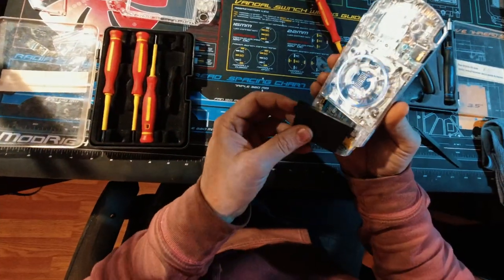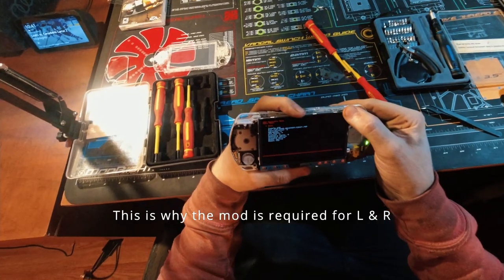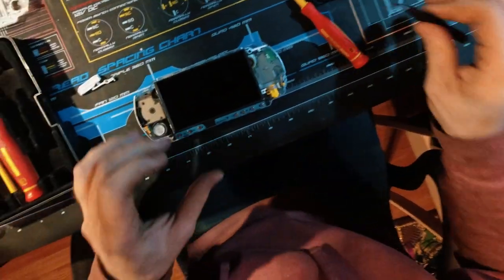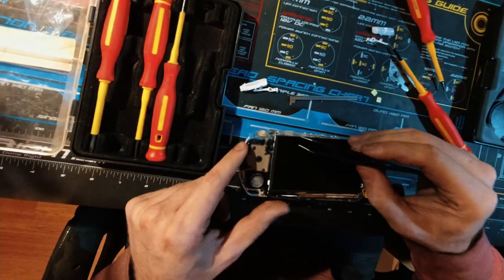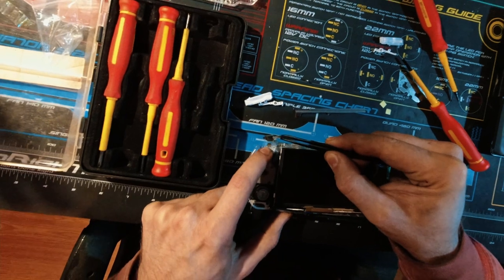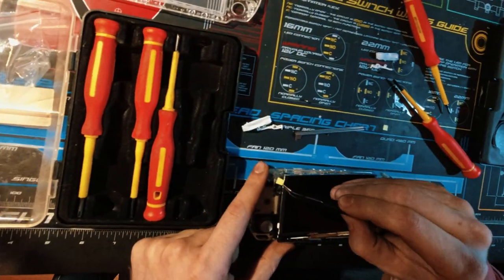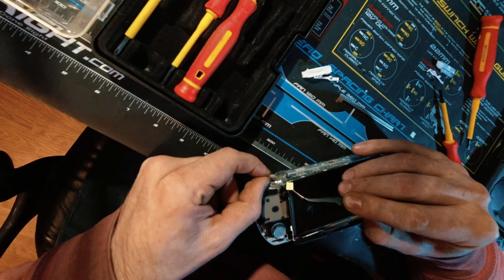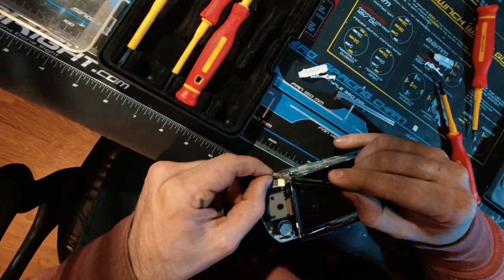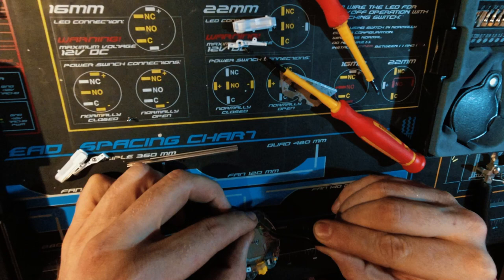So in theory this should work. We're getting a pro recovery menu, so there's a button being pressed — just got to problem-solve the buttons now. After more messing around I realized what the issue was: when I was prying across the bottom to remove the adhesive it actually damaged this inside piece right here, which always makes contact with it. So you just take a tiny piece of paper and you lay it in here, just making sure it goes right in the corner — just to add a tiny little bit of space so that it's not going to squish and touch it again. And we'll do the same for this side.